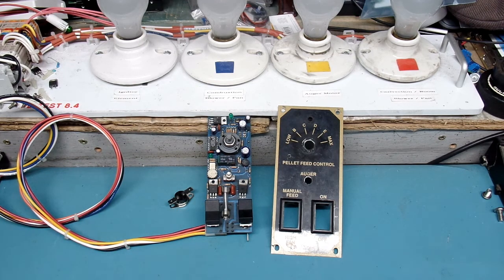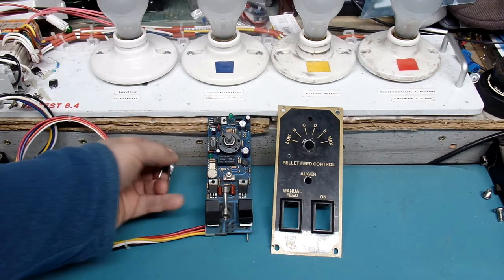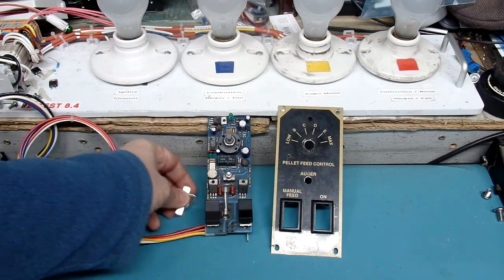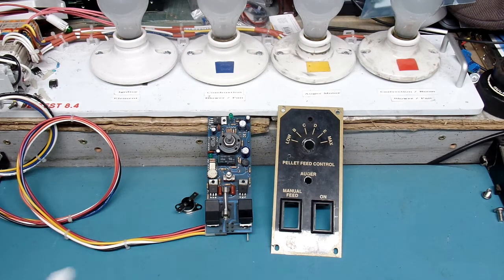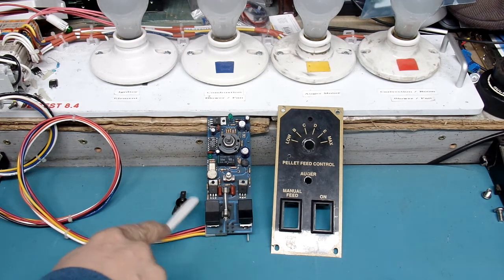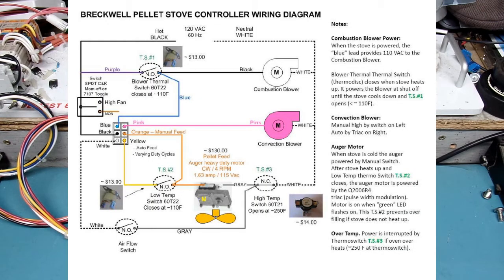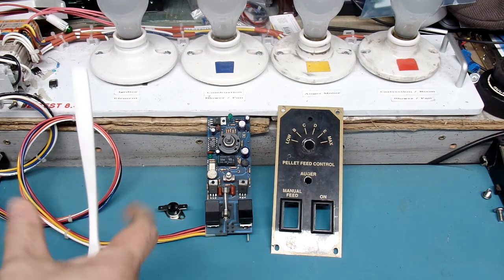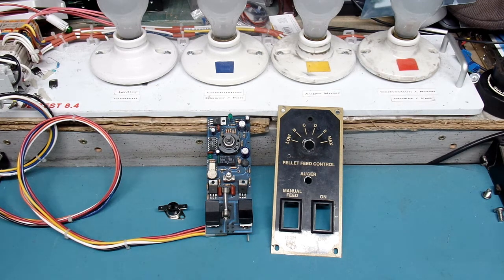The possibility there relates to TS2, which is a 110 degrees Fahrenheit or 40 degrees Celsius switch. That switch looks like this — it should have two mounting screw holes and two tabs to mount electrical wires. On that switch you need to look for an orange and a yellow wire on one side. You may have two orange wires connected to one spot, and yellow on the other. That switch basically makes an electrical connection once the stove temperature reaches 110°F or 40°C.